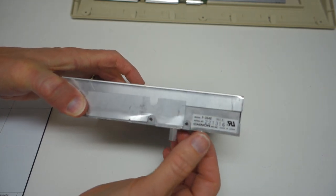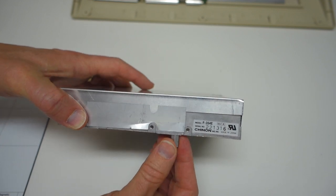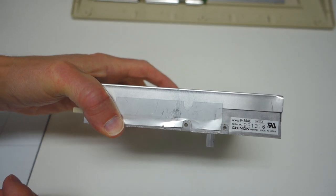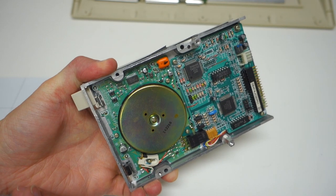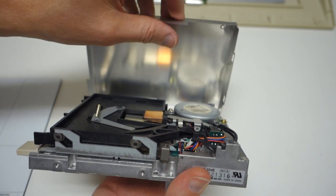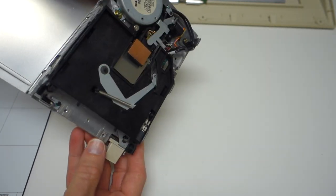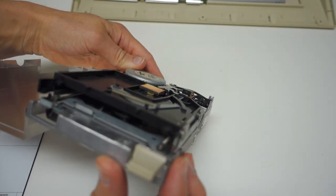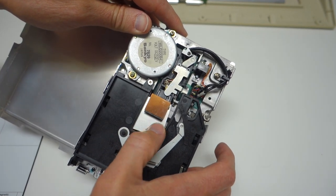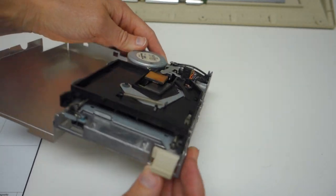Here's the floppy drive — this is made by Chinon, and it's an F354E, which is the standard floppy drive in these Amigas. When I took it out I noticed it's making a rattling sound, which doesn't sound great. Opening up the shielding on top, and looking into the drive I can actually see the problem — there is a shutter from a three-and-a-half inch floppy disk that has come loose and is just sitting in there. This is really good news — if we can get that out of there, everything might just work.